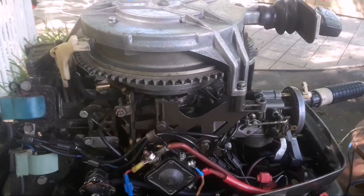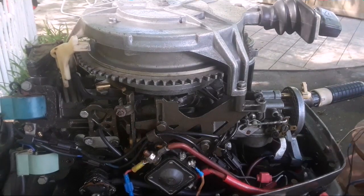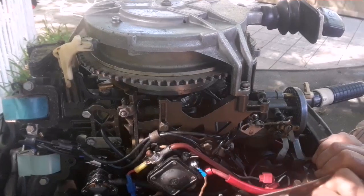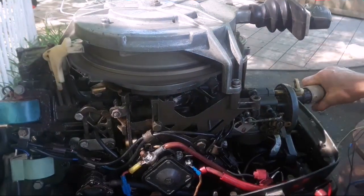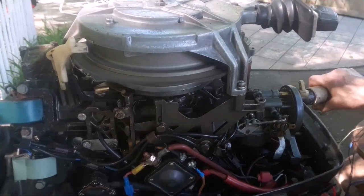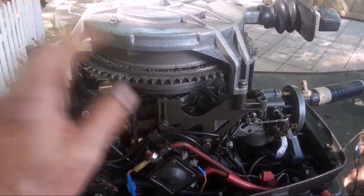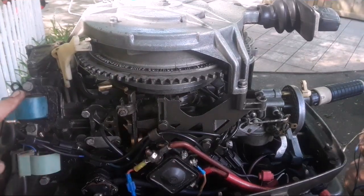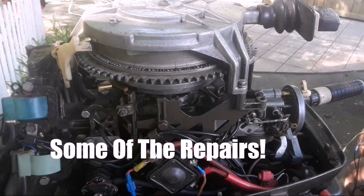Hold on — I think I put the lanyard in there. It's not going to start without the lanyard. That's why I like the momentary factory buttons better — you always forget to put it back in. So that's it for this one. I spent a little over an hour on it. I pulled the points; they were really oxidized and dirty and it didn't start easy because of that, plus I had the intermittent coil grounding problem. She's ready to go — just a follow-up on yesterday's video. Thanks for watching.